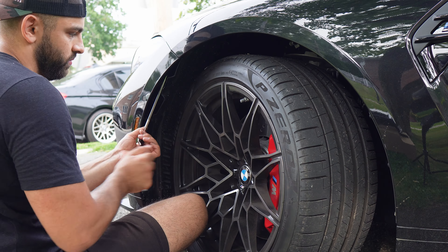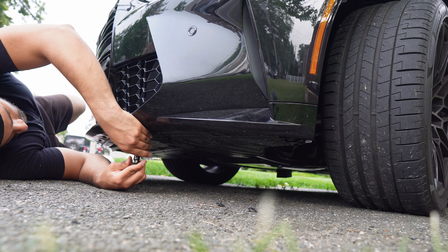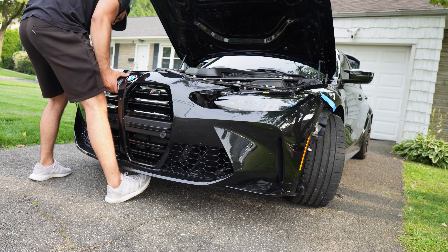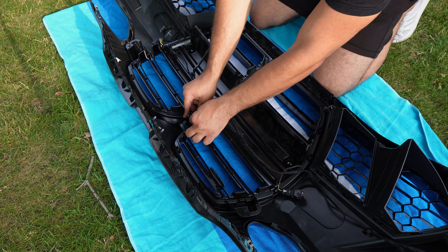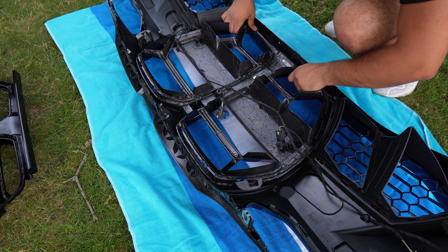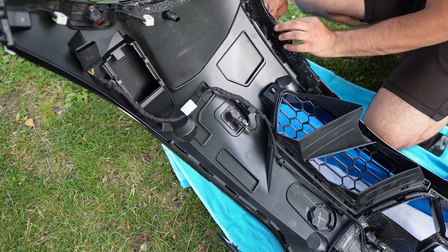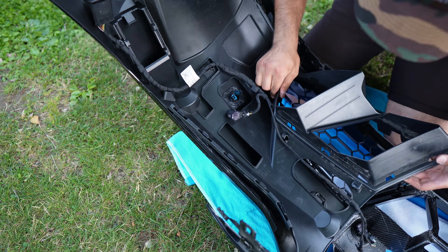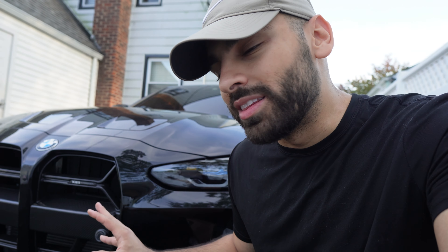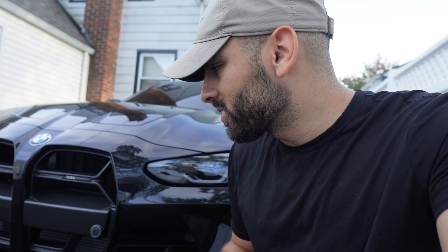The pieces that are difficult are the front grille and front inlets. To install these you have to take off the front bumper — which isn't difficult by itself — but then you need to get it back on with proper spacing and not break anything. On top of that, once the bumper is off, there's a whole bunch of stuff blocking your way: sensors, wires, other plastic pieces you have to remove. It's definitely more involved than older BMWs, but it's not impossible.